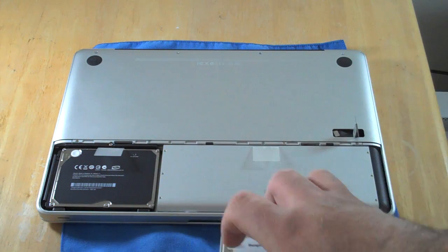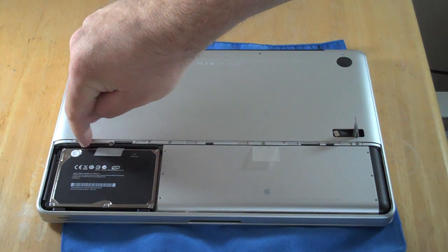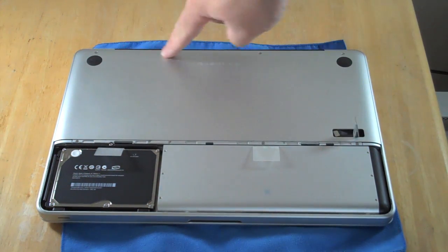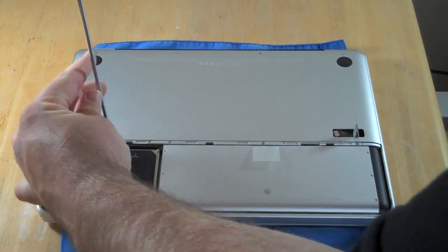Here's the new hard drive, and there's the old one. On this model there is one screw right there. On others there's a screw here and here. If you have the one where this is all one piece, you undo the four screws — there'll be four more screws and then you undo those.